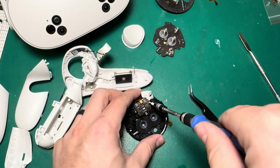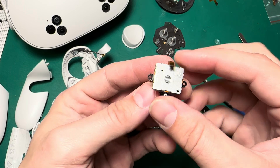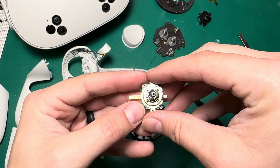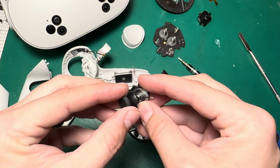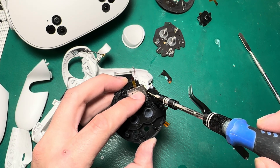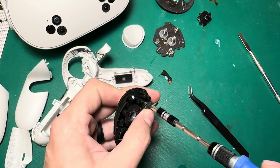I'm going to take some isopropyl alcohol to this just to try to get some of that grease off. Now we're ready to take the joystick out — two screws hold it in, and you can see the gunk on the bottom of the joystick. Somebody's either gotten liquid in there or sprayed WD-40 intentionally. We're going to put the capacitance spring back on so it faces the opposite direction of the cable, then reinstall the joystick. We want to make sure it's seated properly before screwing things in — sometimes that capacitance spring gets out of line and you just have to realign it. If it feels raised up or you can see too much metal, it's not aligned properly.